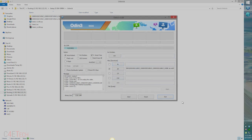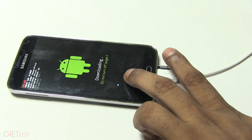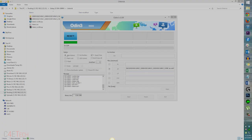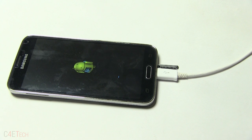All you need to do now is hit Start. This will take about five to ten minutes to complete. Your phone will show a progress bar indicating that the firmware is being flashed. Once it's done, you'd see a blue RESET displayed in Odin and your phone will start rebooting. You can then close Odin — we're done with the PC part of this tutorial. You'll see a green Android icon with a bar running across; wait for it to complete and your phone will boot back up.